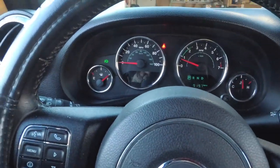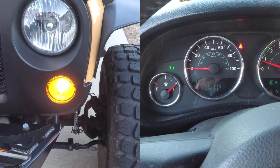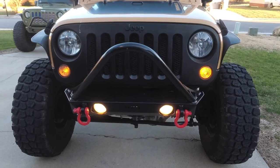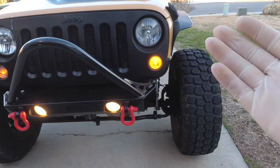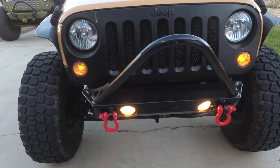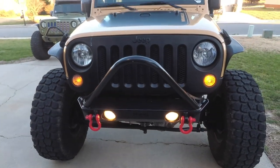As far as redoing all these with LEDs, it really wasn't that hard. The last thing we're going to look at is the blinker — I want to show you what happens so you guys know: if you go with LED this could be a problem. They say you can add a big resistor to slow down the electrical current, but it's just too much. I'm probably just going to put the halogen bulbs back in. Blinker on — we're going good, it's blinking, and all of a sudden rapid fire. That's what happens. This one is a smidge brighter — there's no point going through all this trouble for a smidge brighter. I'm putting the halogen back in. They were like eight or nine bucks so it wasn't that expensive.